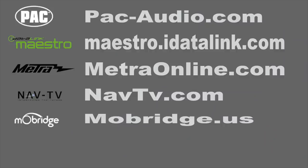More and more cars are coming with premium audio systems. We need to be able to integrate into those. There's a bunch of manufacturers that are making interfaces for them. Because of that, it's become one of those things where you really got to pay attention to what you're doing. You're going to have to do some homework. You could probably just integrate in using high level to low level if you're doing a really basic system, but you are going to run into some audio problems — things are going to sound weird because you're pulling out those factory speakers. Being able to get a preamp output out of a factory radio is ideal because we don't have to fix any of the factory nonsense. However, there's a lot of things going on from the factory — how come we can't just grab into it? We're going to talk about that today, finding the solutions, and go on a journey about putting the amplifiers in this particular F-150.